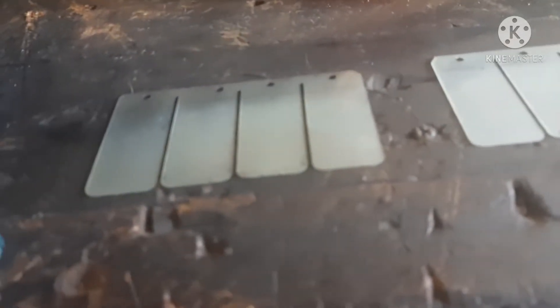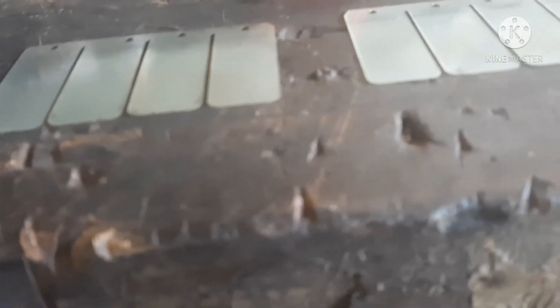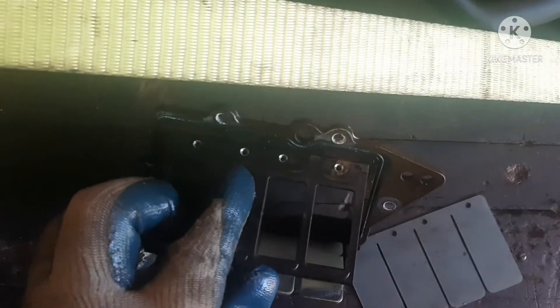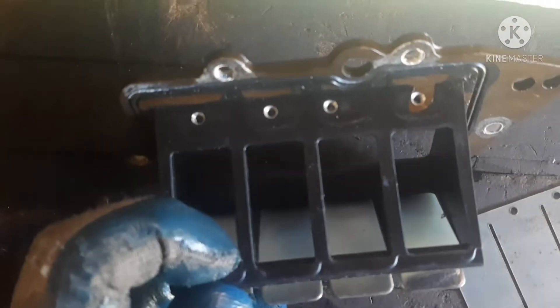I know they can crack and break. I'll put them back in the cage in a minute and see how they look, but so far it looks like this is working. So I'm heat gunning these reed valves. One thing I wanted to note about the Yamaha over the Kawasaki: with the Kawasaki you can flip these, but on the Yamaha you can't, because the screws aren't centered — if you flip it, your two middle ones won't line up.